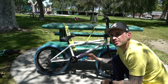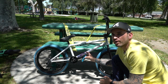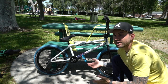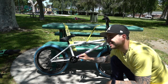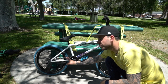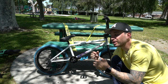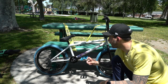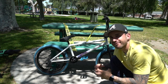The Ravager pedals I ride have a slimmer profile, a little lighter and stronger. You can also get a nicer metal pedal with a sealed bearing and chromoly spindle — a lot stronger, though those usually cost $80 to $90 versus $20 for basic ones. I ride a bash guard sprocket — that guard is made out of metal and sits at a slightly taller profile in the chain so it won't take the full impact of a grind. I also have the Shadow V2 Interlock chain, which is a half-link chain — much stronger and heat-treated compared to a standard full-link chain.